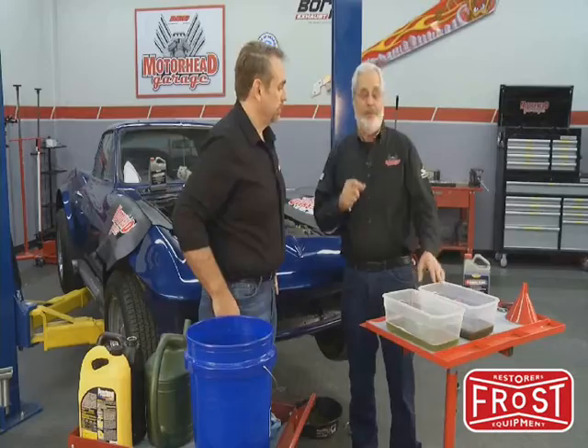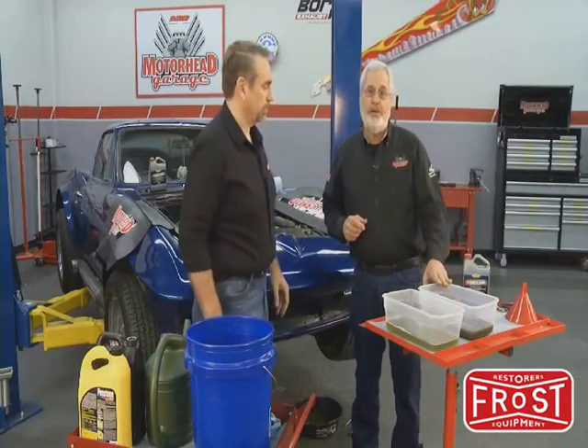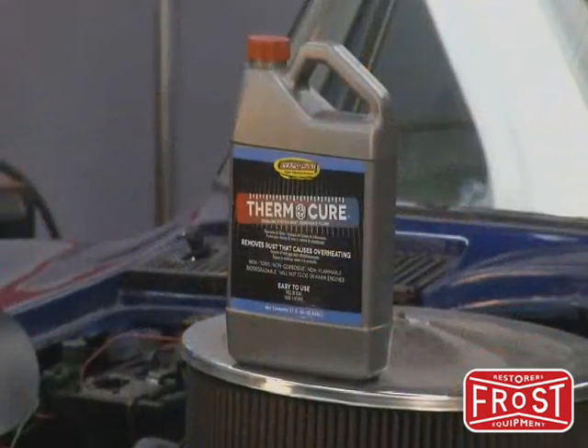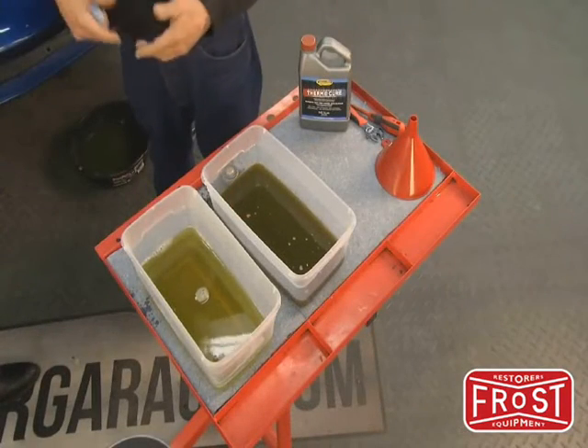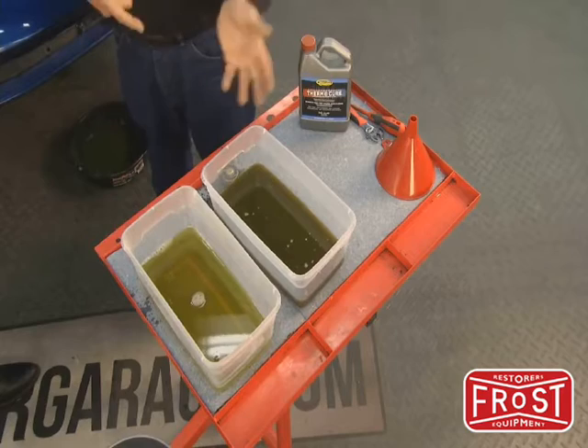You're not going to have any more problems with overheating and clogging. Here's a tip: when you take your first drain after using the Thermocure — it's made by EvaporRust — this is still a good rust eater, so save it. Take any rusty parts or tools and put them in there, or use it to do another car.